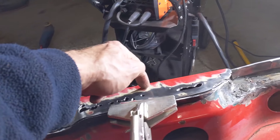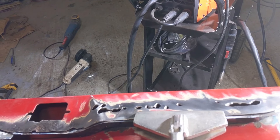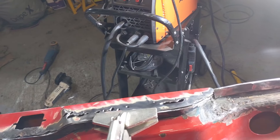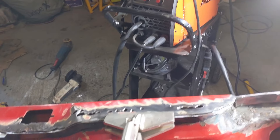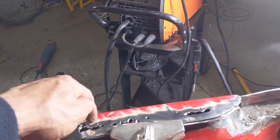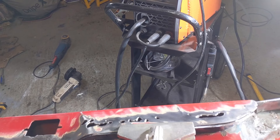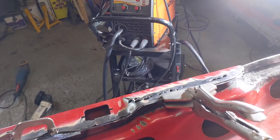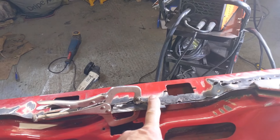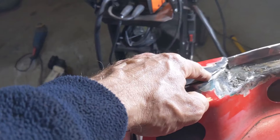So we're going to do it like that - make a patch for that first which we can put over the top. Then we can cut this bit out and tack the other one in place so we know where that piece goes. I'm not sure how it's joined along here - it must have been spot welds. Yeah, it looks like spot welds. So I'm going to have to come in here and take out the spot welds to get out the inner panel.